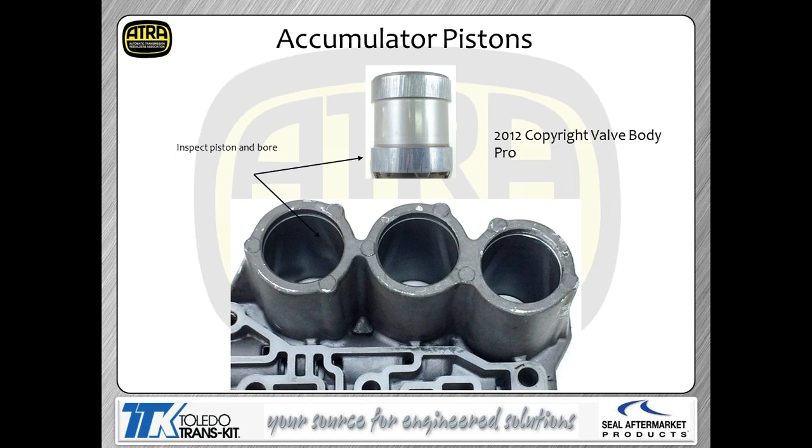Now, Bob provided me some really neat pictures here, which is great because, again, it really helps to actually have a good picture so you guys know exactly what you're looking at here. In this instance, we're looking at the accumulator pistons. You can see the damage on the accumulator pistons. Bottom line is there are kits out there from several different manufacturers to address this as an issue, rather than have to put a whole valve body assembly in the transmission itself.